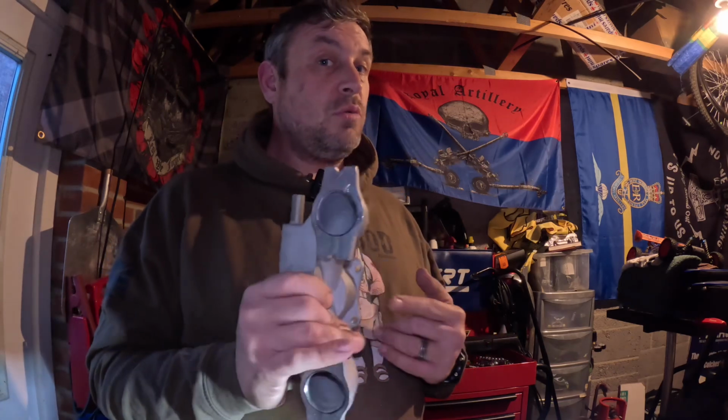Now, if you want to learn more on how to port and polish a Mini cylinder head, get yourself the David Vizard, or Vizard, I think he pronounces it, book, Tuning the A-Series. He goes in depth and explains how to do it really well. And you know, it's little bits here, little bits there, little bits there. Massive progress. Get it wrong, and even I could get this wrong and go through the casting. I know it's quite thick, but you could easily get that wrong, and you could ruin a cylinder head. So be confident you know what you're doing. Don't just go wild at it, because you could destroy your engine.